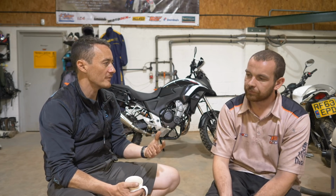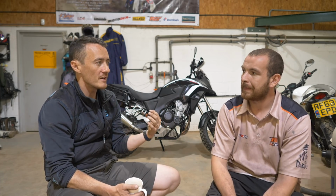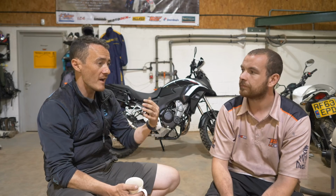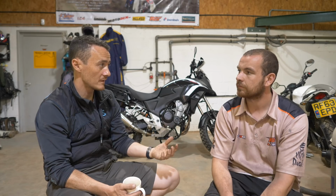When you start talking about preload and adjustments and all that kind of stuff, I assume that's for the Dakar guys who want to put in good lap times and all the rest of it. But the interesting thing we were talking about earlier is I might be riding this bike with no luggage, and then the next day I might put loads of luggage on, and that's going to change the weight on the bike. So being able to very easily adjust the suspension compensates for that.